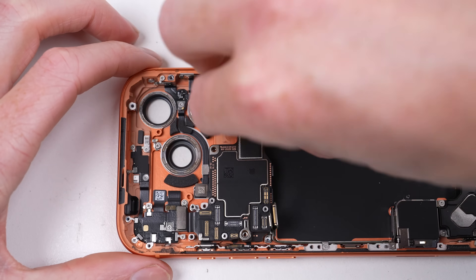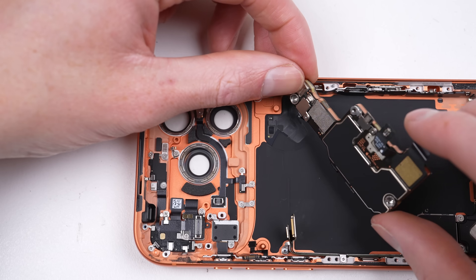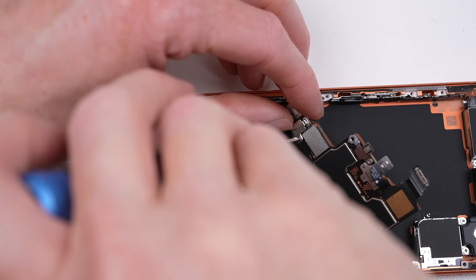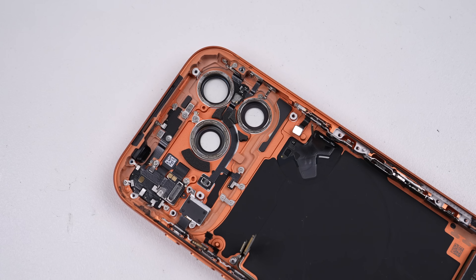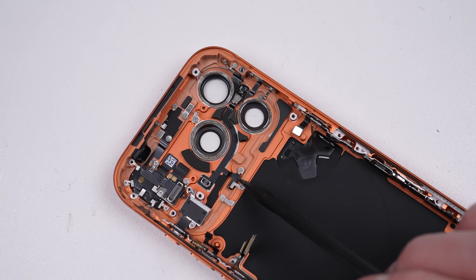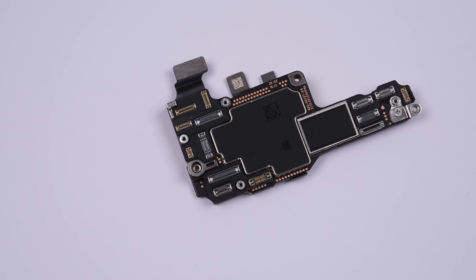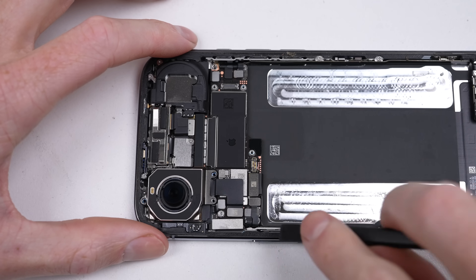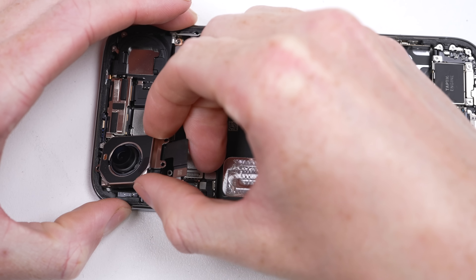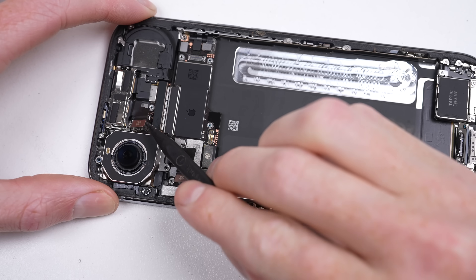As we've not yet attempted to remove the back glass panel, there's a flex cable for it located under the board. Folding it to one side, its bracket can be unfastened and its cable unplugged. With that, our logic board is free. In what Apple calls the plateau is the LED flash, a microphone and antenna hardware. With the Pro's logic board out, it's time for the Air. Learning from my experiences with the Pro, I'll start with the camera — although even after its screws are removed, it's not coming out. I'll remove the Face ID hardware to have a look at what's preventing it from detaching.